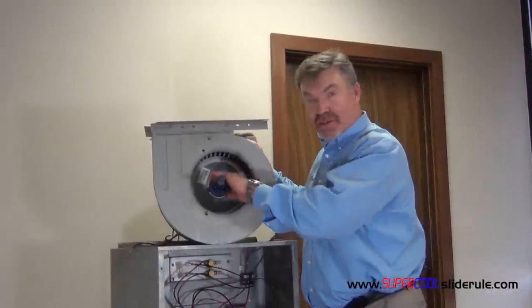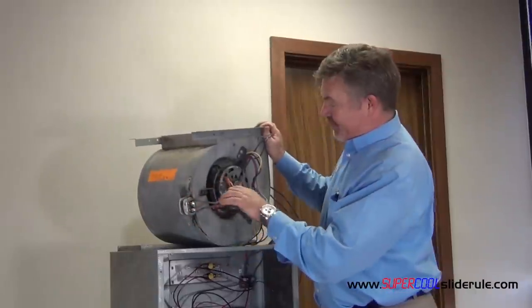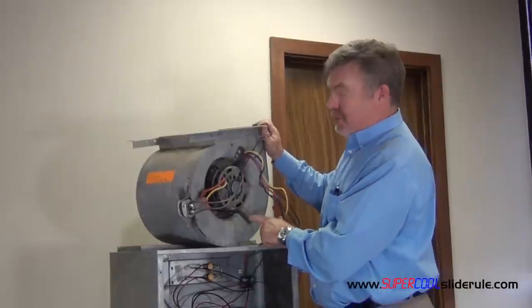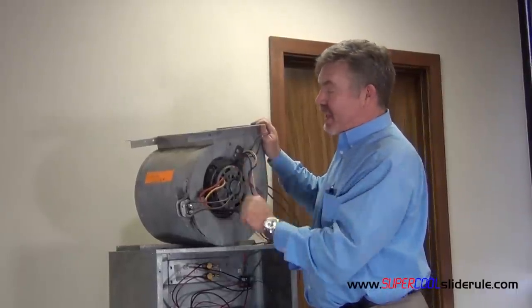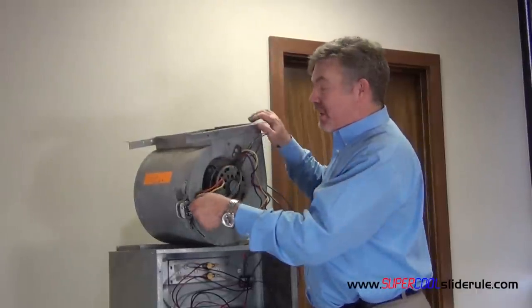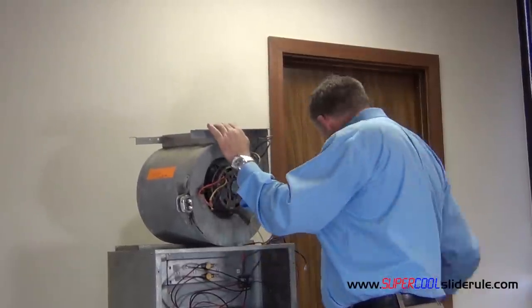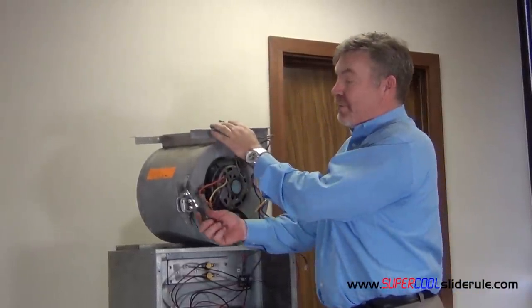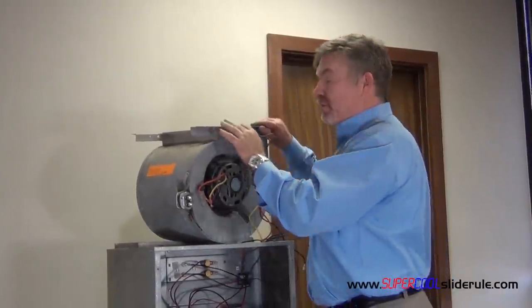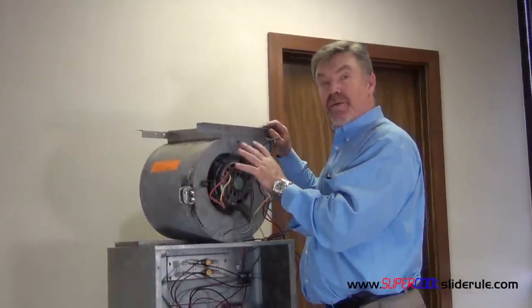One thing I forgot — this is all tight. On the back side where the motor is, we have to loosen our screws, bolts, or nuts — whatever we have on that side. Loosen those and completely remove them. Disconnect the leads to your capacitor. It's a good idea to short out your capacitor so you don't get a jolt. Always replace your capacitor when putting in a new motor — don't take any chances, just do it while you're in there.